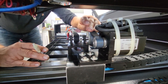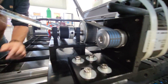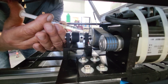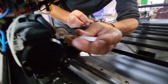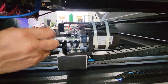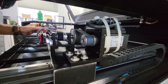On your motor and your gears here — some of you have experienced clicking noises and the clicking is going to be coming from here. This almost never has to be oiled; if you do have to oil it, once a year will be fine. All you're going to do is put a few drops of oil in all areas — wherever there's a joint, put a little bit of oil in there. Move your head back and forth. If your machine is clicking after you oil it, you're going to have to run it for about an hour before the clicking noise will go away — but it will go away.